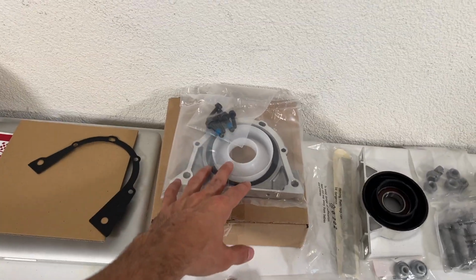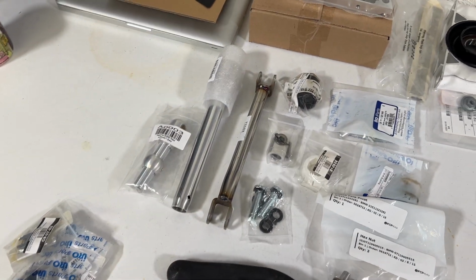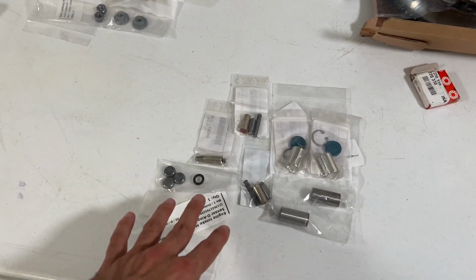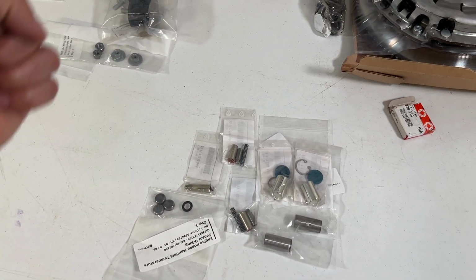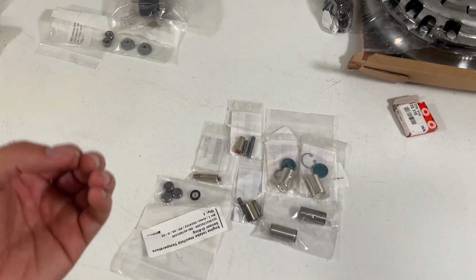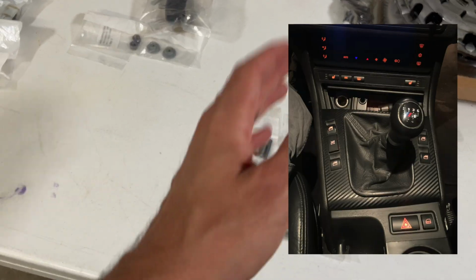So yeah, rear main seal, very important. Below that, we got our short shift kit, which you guys have seen before. But since we are taking the transmission out, we're going to be replacing all the components of the transmission and the short shift kit. So super, super stoked about this. Not only are we going to do the short shift kit, I think I mentioned this in the first episode, the Detent Pins. I have a ZF 5-speed transmission, and something very common with the 5-speed is these Detent Pins get kind of gunked up, and your first gear and fifth gear, even reverse gear sometimes, is either hard to get into, very vague, or when you start the car in the morning and the temperature in the transmission is still cold, the shift knob leans to the fifth side, so it doesn't sit in the center.